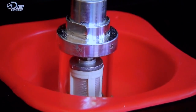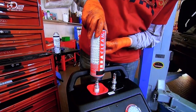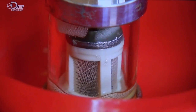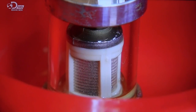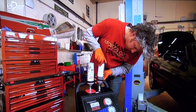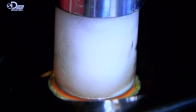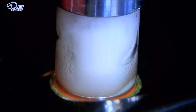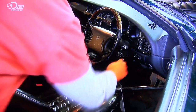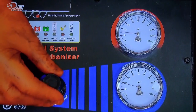The highly refined fuel is actually two elements that clean different parts of the engine. One side is for pre-combustion, that's all the mechanical elements up to the combustion chamber, and the other cleans everything from the injectors through to the very tip of the exhaust, including the cat. This stuff is so much more thorough than a £20 engine flush chemical from your local motor factor. The engine needs to be warm, and I'll fix the throttle at about 1200 RPM, which is faster than tick over and will help suck the fuel in.